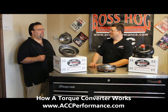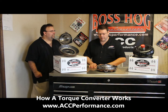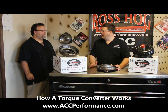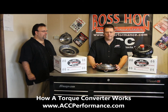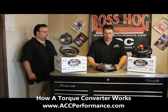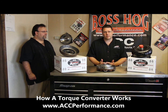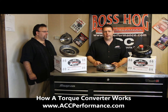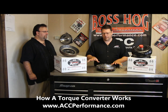I'd like you to explain to our listeners what a torque converter is and how it actually works. A torque converter, very simply put, is the clutch for the automatic, as the clutch would be for the manual. It is operated by hydraulics, or transmission fluid in this particular case. Most of the fluid being pumped throughout the torque converter actually uses the centrifugal force of it turning, bolted to the flex plate of the motor, in order for it to start pumping through the torque converter.